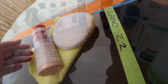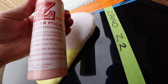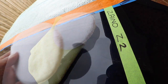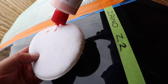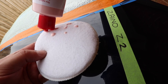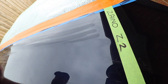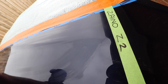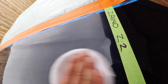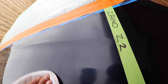Just like EXP, if you really want to get the most out of Z2, it's best to leave it on the paint for a good hour or so, and you'll benefit from both increased gloss and durability in its finish. And although both of these products are quite sun friendly, it's best to shorten the time you allow them to sit on the paint if working in direct sunlight. Another similarity to EXP is its layering ability and its acceptance of allowing other sealants to bond alongside it.